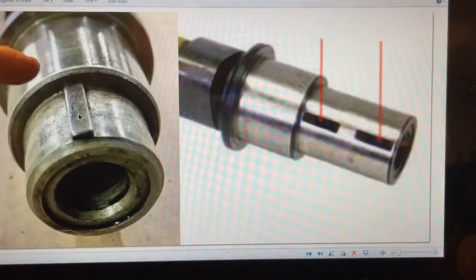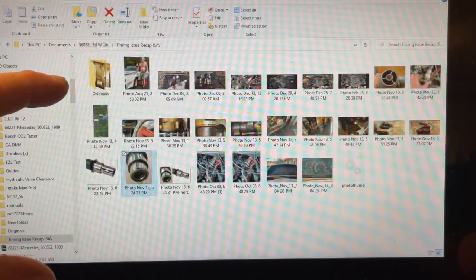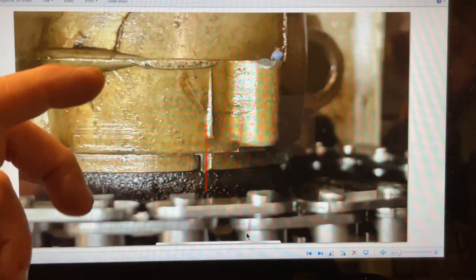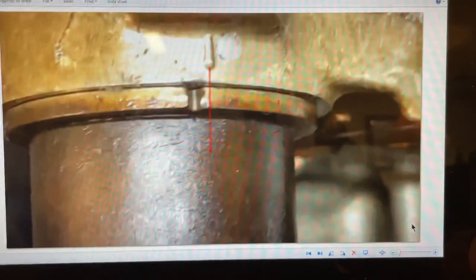Otherwise I would have fixed this a long time ago. Before going to the options, I want to explain why we came to this situation. We know the driver's side is correct, the left side is correct, and the crankshaft pulley is correct — all timing lines up. But why do I have a two-to-three degree offset on the passenger side, now past top dead center? The problem is there are several sprockets: two camshaft sprockets, one for the distributor, the crankshaft sprocket, and another one on the left as a guide. All of those wear out, and this engine has 333,000 miles on it.